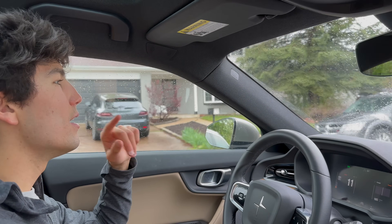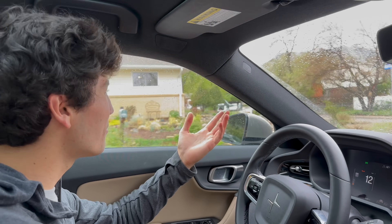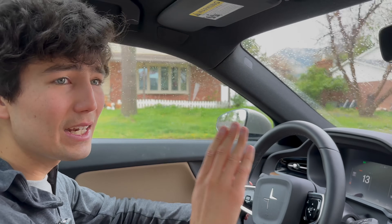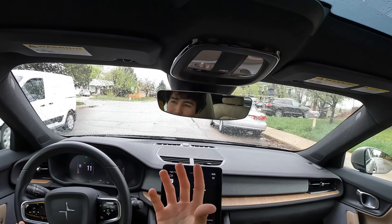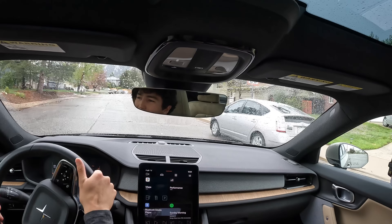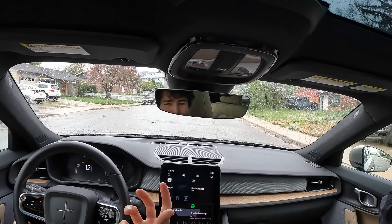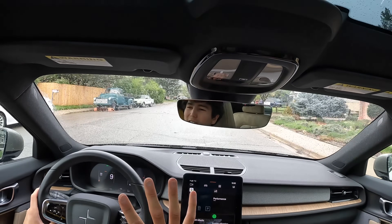The difference Tesla has is that many automakers, since the dawn of the modern electric car — going back to the GM EV1 if you want to be a throwback — have done what's called brake blending. They use really interestingly engineered and honestly quite complicated systems where, when you press the brake pedal, they apply a little bit of regenerative braking first, using the motors to brake, and then as you need more — say more than about 0.2 g of braking force — it steps up friction brakes, blending both into one seamless pedal feel for the user. Different brands do this to differing degrees of success. Mercedes has what they call a dynamic brake pedal, and it is, to put it nicely, extremely controversial — the pedal will actually move further away from you, which many drivers including myself find extremely disconcerting.